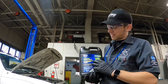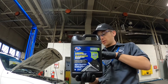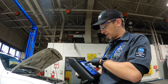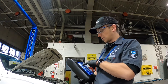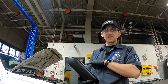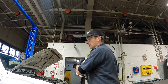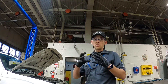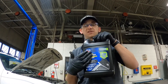If you read the instructions on almost any of these one-size-fits-all coolants, it's going to tell you that a complete drain, fill, and flush is required. This one says: drain to remove rust sediments from radiator, close radiator valve, flush to clean engine block, fill with clean water and cooling system flush cleaner, run engine with heater on high until operating temperature, stop engine, allow to cool, drain again, close radiator drain valve — do this until clear water is seen. Where people get confused is they think 'all makes and models' means they can just pour it into their GM truck that has orange coolant. That is incorrect. You can mix coolants that shouldn't be mixed together, causing them to react improperly and do more damage than good. When you see 'one size fits all' on a bottle, it's never truly one size fits all — you have to read the instructions. The reason it says all makes and models is if you completely flush all the coolant out, then you can refill with it.